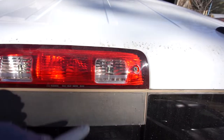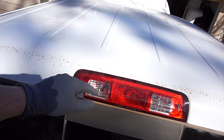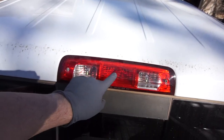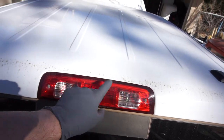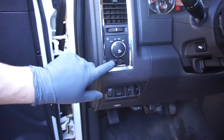I've got the cargo lights in here — just two screws, really easy. Loosen them and you pull them out. One of these bulbs was blown, so I took it out and put a new one in for the third brake light. The cargo light button is right there just in case nobody knew where it was.